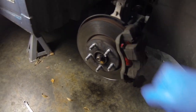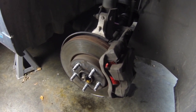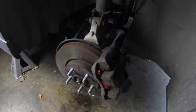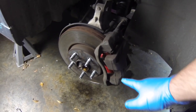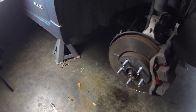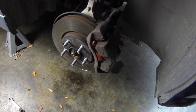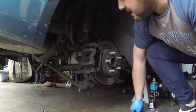We've got that all sorted out now. I might spray it down one more time with brake parts cleaner just to make sure everything's uncontaminated. The difference with this side is that I left the top bolt on, so you can actually swing the whole caliper up — that's one way of doing it, or you can remove both sides, either way it doesn't matter. We're going to move on to the back now — I'm going to take this off the jacks, put the wheels back on, and then we'll be getting the rears done.